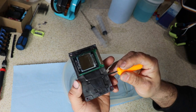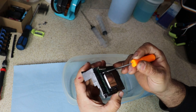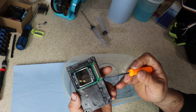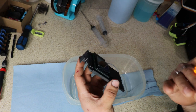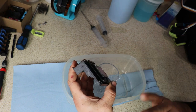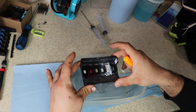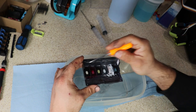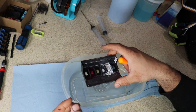I'm going to turn this around and the areas that you want to make sure are always dry is pretty much around this area right here. You never want ink, anything, water, solution — anything to go around this area. If you get water in this area it's going to become moisture, and then eventually you're going to get code 031-004. Another thing I'm going to do is I don't put it flat on the cup — I put it at an angle, so if any liquid comes in here it will actually go into the back and then drain. So let's start with just cleaning the printhead around and then we'll move forward.